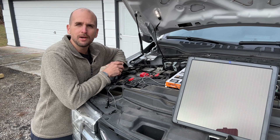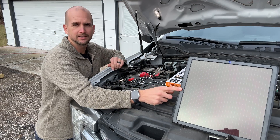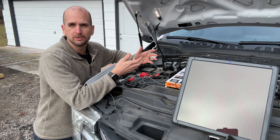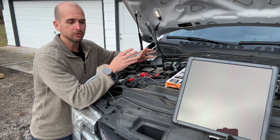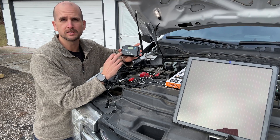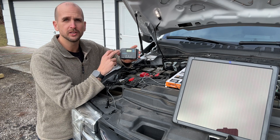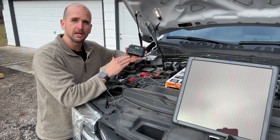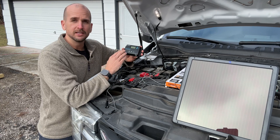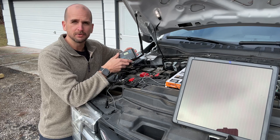How's it going you guys, it's Scott with Everyday Solar. Today I want to test out: can you directly connect a solar panel to a 12 volt battery? If you have any experience with DIY solar, the answer would be no. You would at least need a simple PWM charge controller, like this 10 amp charge controller from Renogy. You plug your battery into the charge controller, then you plug your panel in, and it manages the power flow into the battery.